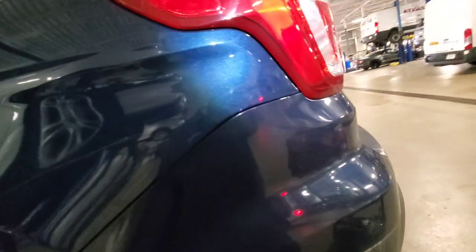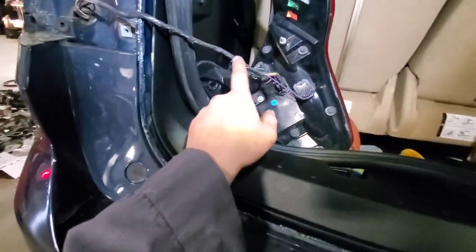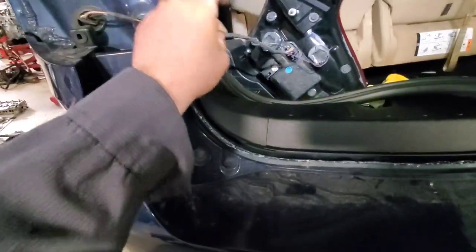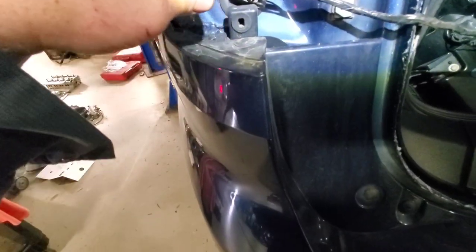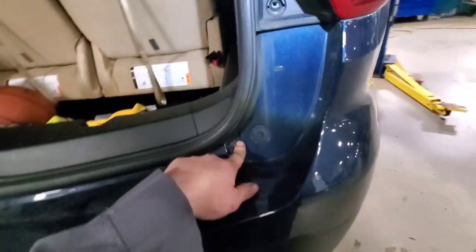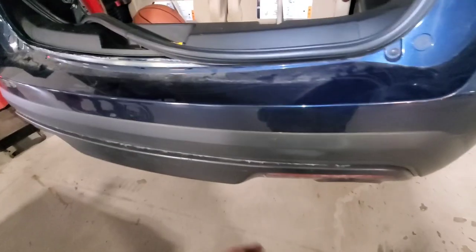Go do the same thing on the other side. Now I've pulled the bolts out for the lights and I'm going to pop the lights out because I think there's a screw back here. So what I did was I took this wiring harness and actually unhooked it from the hook right here and just lean it up - no stress, it's not pulling on the wires too bad. And there is a Phillips push clip here, so you're going to have to back this out. Sometimes you got to put something under there and pry while you're backing the Phillips out, then pull that out. Then you can come down here and get this one out, and then over here same thing behind this light. Then work on this side and get this side apart as well. Underneath you're probably going to have a few screws.